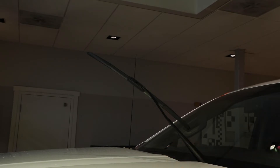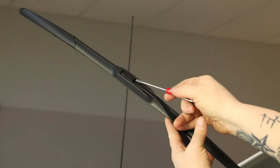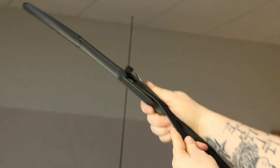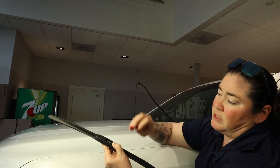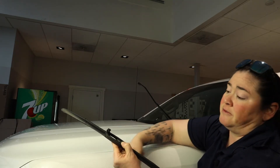For this particular model, it's a GMC truck. This little tab right here — you get a small screwdriver, lift underneath it, and that'll open right up. Once it opens up, you can slide it down and they come right out. So as you can tell, this here is your locking mechanism. Once it's on, that clips down and keeps the wipers in place. To release it, just get underneath it to lift it open and then you can go ahead and take care of it.